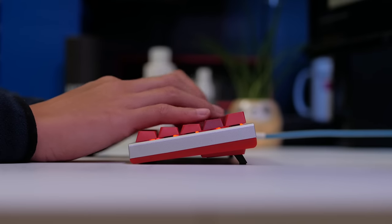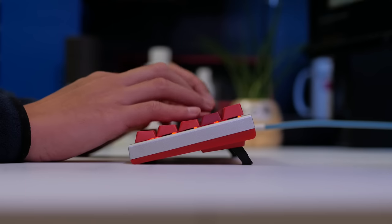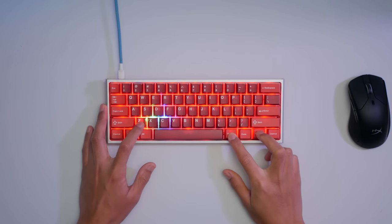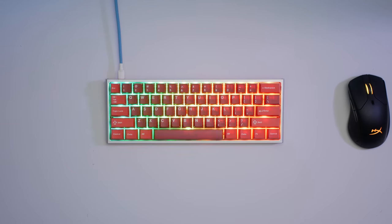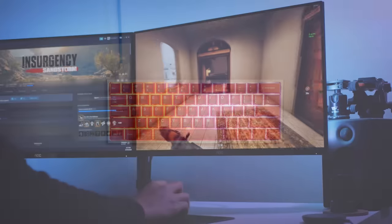Also, with the plastic case, the bottom mount just doesn't feel as tight as a high-end custom would be. Not sure how to explain it, customs can have that bit of give and flex, and that's what many are designed to do, but it still feels solid as it's usually to do with the plate mounting. With this, it feels like I'm feeling the table when I type, that sort of bassy feel, so it doesn't quite reach that custom level and you wouldn't expect it to, but it sure is a whole lot different to how it felt stock. And besides the weight of the springs, it's a really enjoyable typing experience. Oh, and the stabilized keys are much better, no rattle, and have a thockier sound and feel.